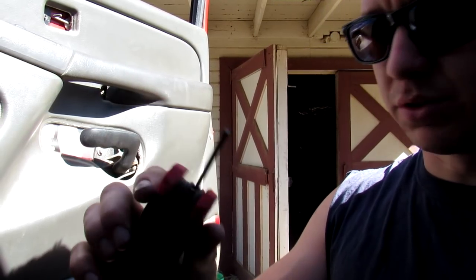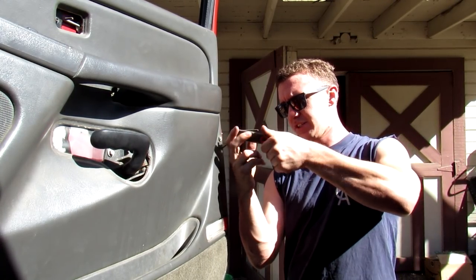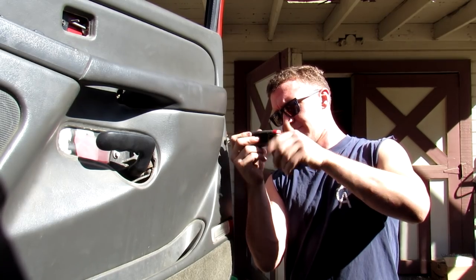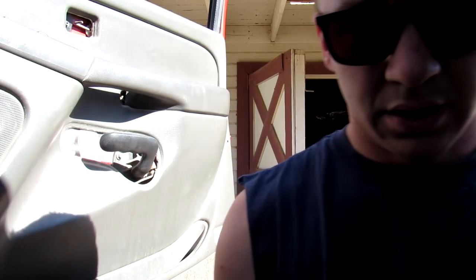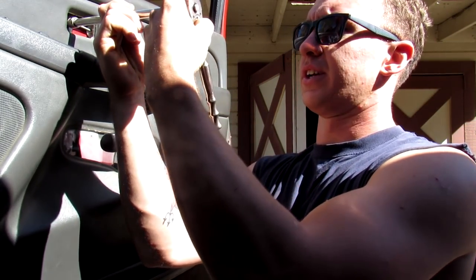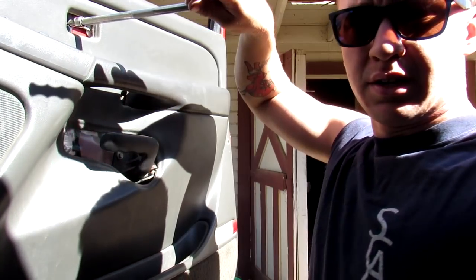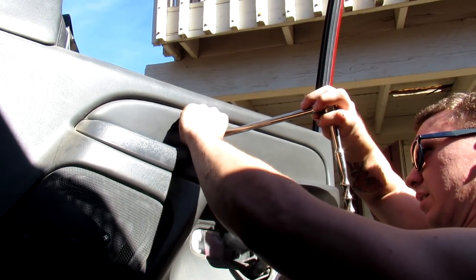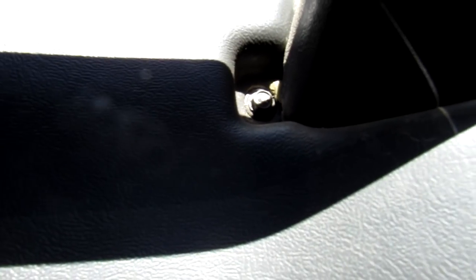I'm telling you guys this takes like five minutes. You need about four tools for this, one being a T20 Torx tip bit for the screw right back here. Obviously if you're wiring it properly it takes a lot longer because you have to make all your own wiring for the reverse lights and all that, but like I said, strictly plug and play right now. There's one screw. Next you're gonna need a 7mm on a ratchet handle. There's a screw up in the area where you took the lock slider off, and there is a screw underneath the door handle here.